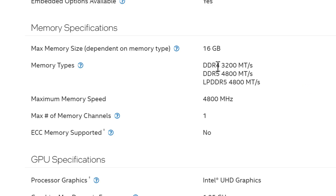In addition to the N305 processor, the EQ12 Pro sports DDR5 memory. Intel ironically says that the N305 supports a maximum of 16 gigs of DDR5 memory. However, many in the forums and around the net have said they have successfully been able to install 32 gigs of DDR5 memory. When I saw this, I ordered a 32 gig stick of DDR5 memory and had no issues with this unit recognizing the 32 gigs. I also had a commenter on Virtualization How-To who was able to actually install 48 gigs of DDR5 memory in his particular unit with the N305 processor.